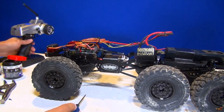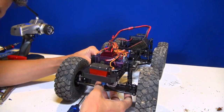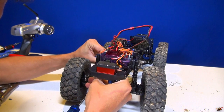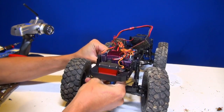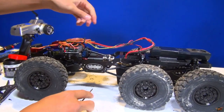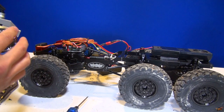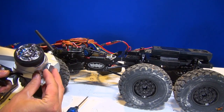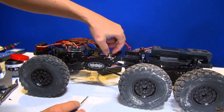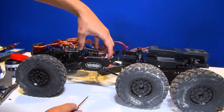I could use a stronger servo, that's for sure. And I see that one of my links while I've been working has actually popped out — looks like I lost a screw. That's what it's up on the bench for anyway. I just want to keep on with centering out this horn. Battery's there. If I want to look at the transmission shift — I haven't attached it to the actual transmission shaft yet; I just wanted to see how far it had to go. That should put it in the low gear in the far position.